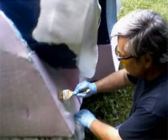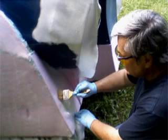Something else that was a complete surprise was that when the white fiberglass cloth is wet with the epoxy, it becomes completely transparent. Here's a picture of me working on the left rear fender. As the epoxy is applied, the old blue fiberglass can be clearly seen. The fiberglass all flowed perfectly into the corners and adhered to the curves without any additional cuts.